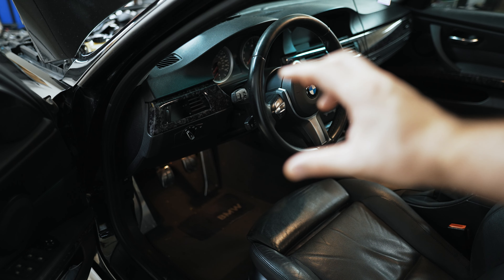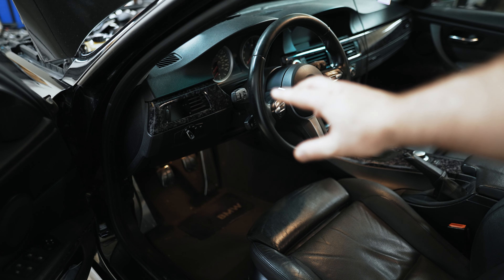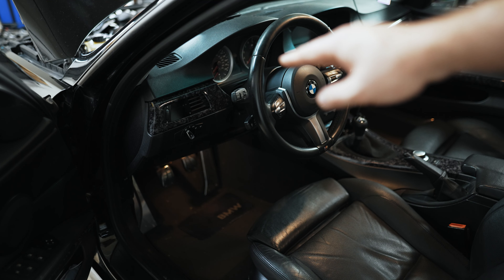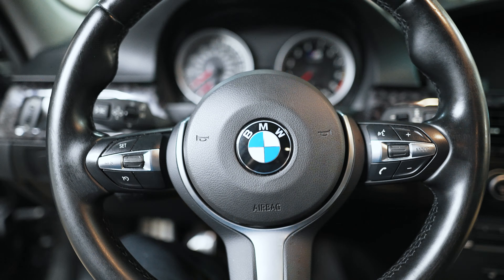The electric motor spins the opposite direction to make the steering less direct, giving a more stable highway feel. Normally with a steering rack you'd have to choose between a good ratio for town driving and not feeling nervous at highway speeds. This system gives you a ratio that would otherwise be unattainable, varying the ratio like an S-curve depending on vehicle speed — and at high enough speeds, even less direct than a regular rack.